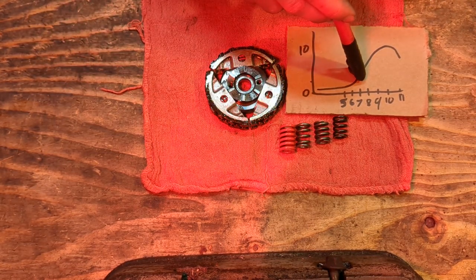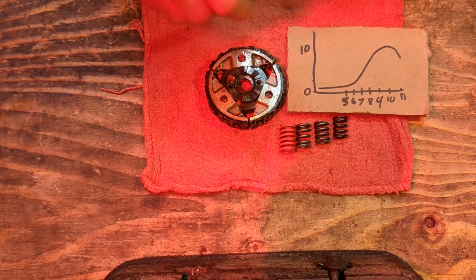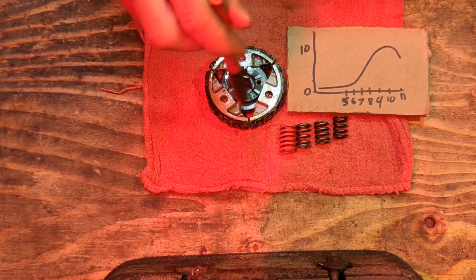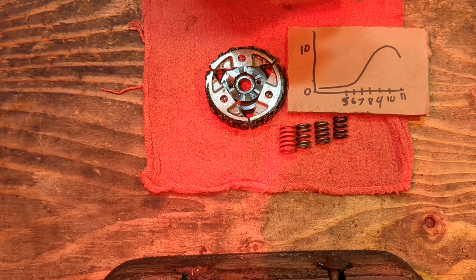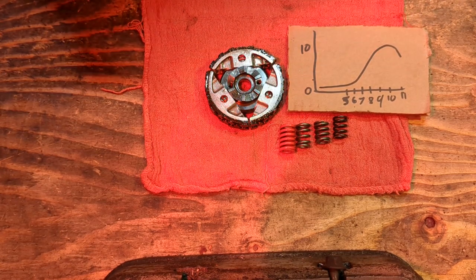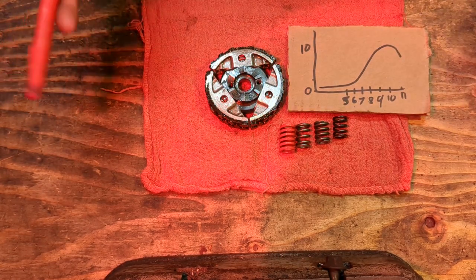And there is no way to get into the RPM band unless the wheel speed traveling through the gears and the chains and the mesh matches with that clutch speed. So you have to be going, I don't know, 20, 30 miles an hour if that clutch is locked before you actually get to that 10,000 RPM power band. Okay, let's break that down. Does that make sense? Maybe I should just show you.